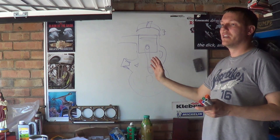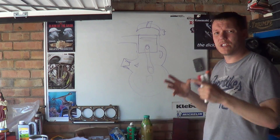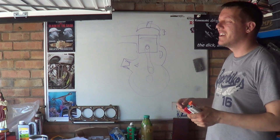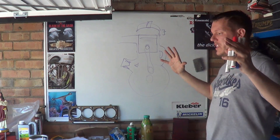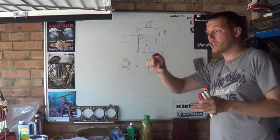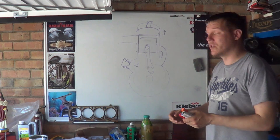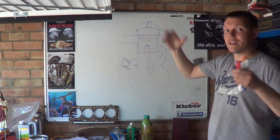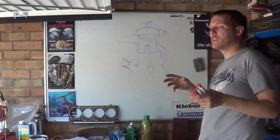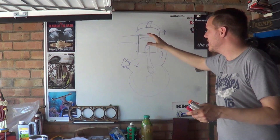So your pressures are rising quite rapidly because the piston is about to get to top dead centre. The temperatures are getting really high; the pressures are quite high. Pressure increases because of temperature - just like with a bike pump, when you pump it you can feel heat - you're squishing the atoms together. Basically, this volume of gas had a certain temperature density, and when you compress that into a smaller region, your temperature per cubic centimetre is going to increase. So the pressure is quite high in here, and to spray in like a diesel does near TDC, you need quite high pressures - we're talking 50, 100, 250, 300, all the way up to 500 bar, depending on when you want to spray your fuel in.